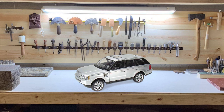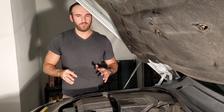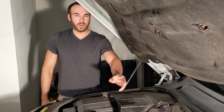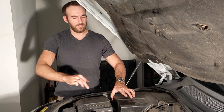Park the car and open the hood. The next thing you need to do is disconnect the air suspension power supply so it won't raise, level, or change anything overnight. There are two ways to go about this: you could disconnect the battery, which will work, or probably the easier way would be to disconnect the fuse. The battery box houses both of these things.